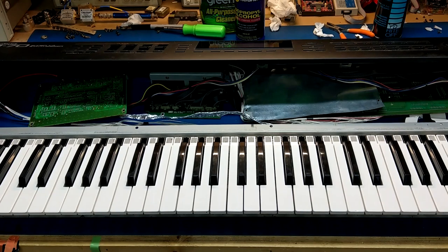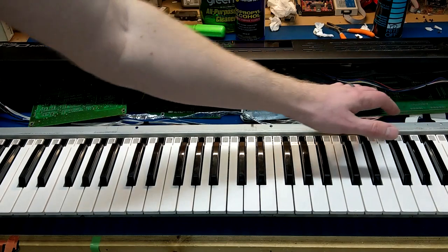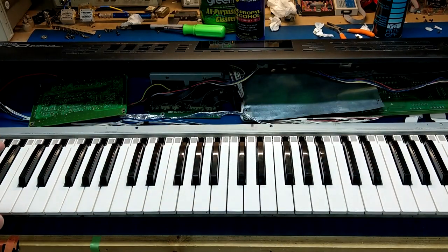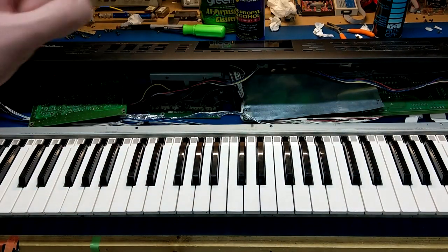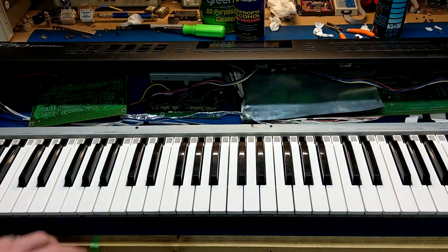While I have it open here on the bench, there's something I really like about the D70 that makes it easy to work on. Because there are these two long ribbon cables that connect the keyboard to the actual main board on the unit, you can pull the entire keyboard out and still have the entire unit powered on. It's nice because as you're working on individual keys, pulling them out, cleaning the contacts, putting it back together, you can quickly turn it off, turn it back on, test it, and pretty much debug it while it's powered on in terms of the individual key contacts.